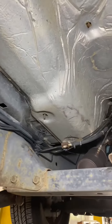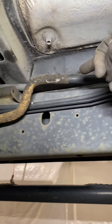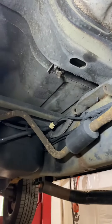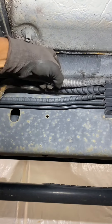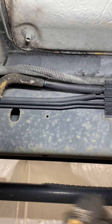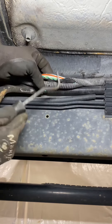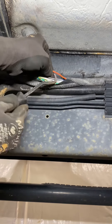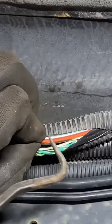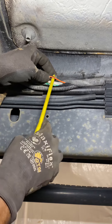Going from the front to the back — if you look here you'll see the wiring harness traveling all the way back to the fuel pump. So if we hijack this harness right in here, we're looking for an orange with a red. Looking through the harness — there's only one orange wire right here, and it has a red streak on it.